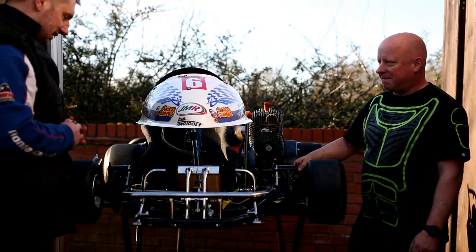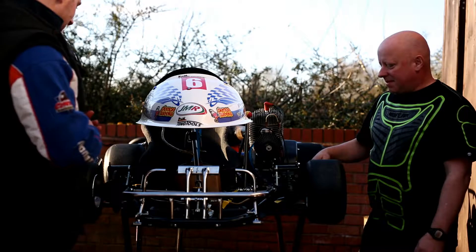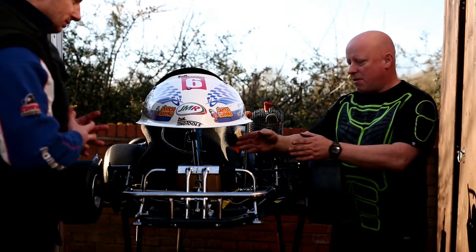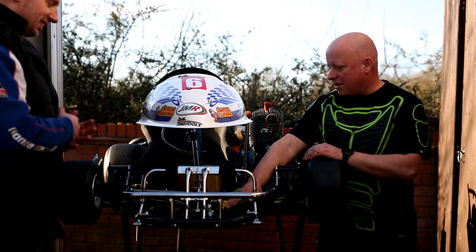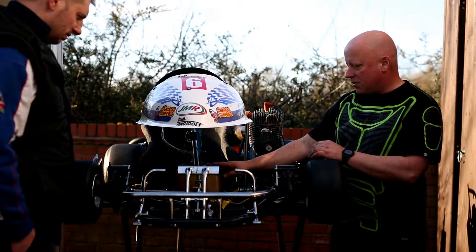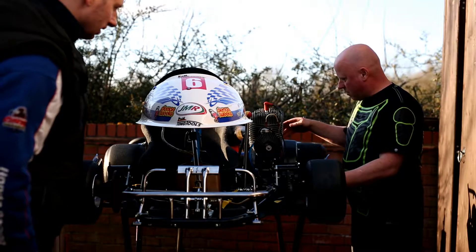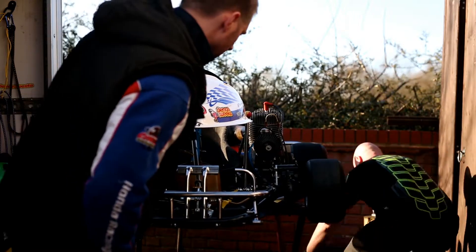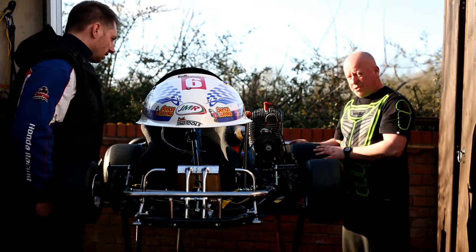The last two or three days have been a bit hectic pulling it all together but as you've seen it's now running — two or three hours and it'll be ready to go. What special features have you got in the kart? So obviously I've modified the pedals slightly to bring them further back, I use heel stops to get a good grounding in the seat, and I use a specific quite short tank so I can get my legs up and over them. I've also got quick-release detachable side rails so we've got quick access to the engine, and the chain guard pulls off fairly quickly too.